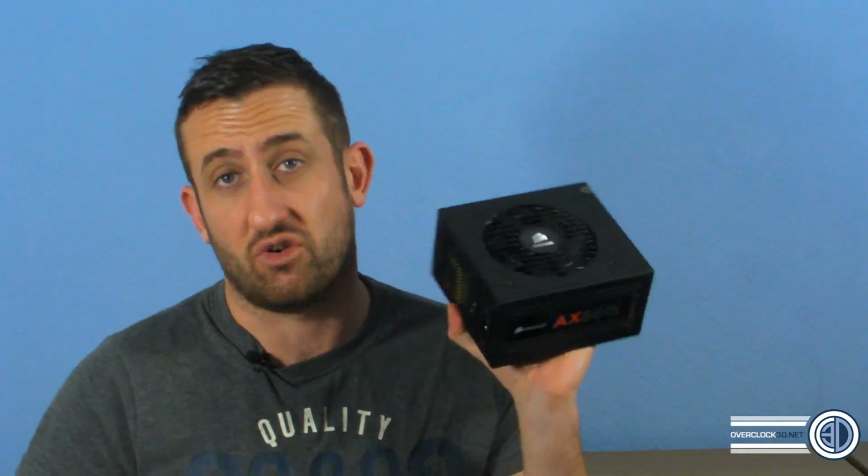But we've gone from the old style Seasonic based AX850, which is what we compared with today, and then we're into the new Flextronics based AX860i. Now, I have spoken already about the cables, but just so that you know, the new AXs that are platinum with the red, so the AX860i, AX860 without the I, AX760 without the I, and the AX760 with the I, there will be new individually braided cables coming through soon. But the older models and these models, the cables aren't interchangeable. So the individually braided cables that are out on the market at the moment for these ones, you cannot use on the newer ones. The 24-pin configuration is slightly different on these. I don't know what the effects would be, but I sure as hell wouldn't want to be shoving one in my motherboard to find out.